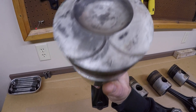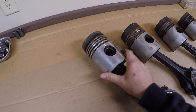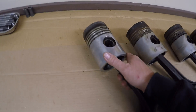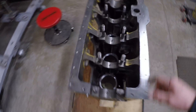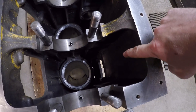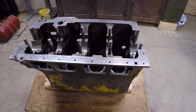The V-notch is on this side, and looking down, the rod number stampings are also on the same side — you can see the 'one and one' right there. They're actually supposed to be on the other side. As we determined in the last video, at some point in 1113's previous life her engine was rebuilt because she's got the updated pistons, and someone also put the rods on backwards. That doesn't matter functionally since these are symmetrical rods, but as a convenience factor you'd want the number identification stampings on the camshaft side so you can see them through the side inspection panels.